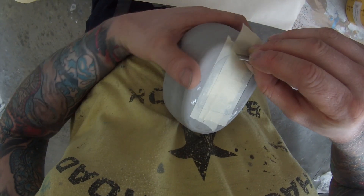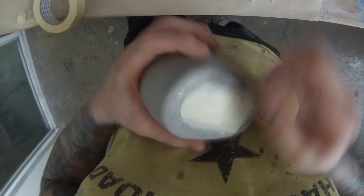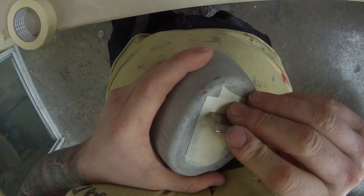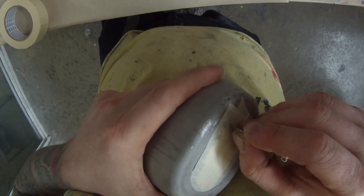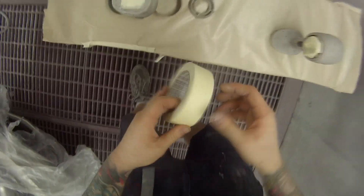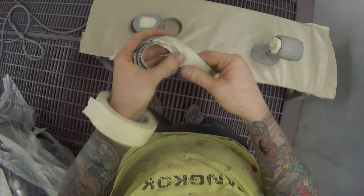A lot of people used to have a backup battery pack. I've only ever had one, and what I ended up doing is taking this battery pack down to Battery World — which you have here in Australia — and they're actually able to repack it for me. That's a big part of the reason you see me masking this bottom part up; there's some info on the battery that the guys from the battery shop are going to need. So it cost me $80 to get that repacked, which beats buying a new battery pack for probably $200 give or take.